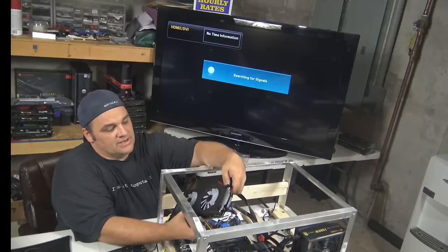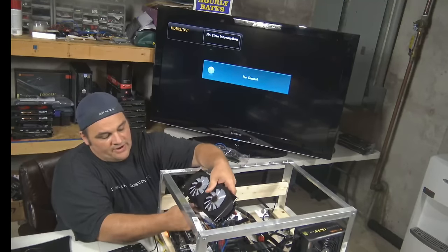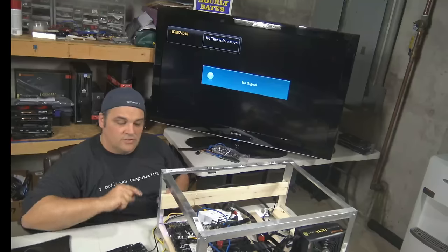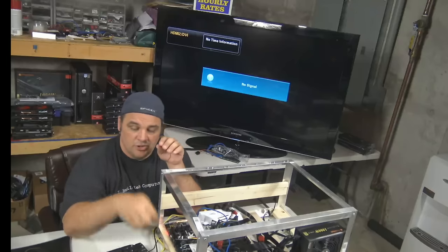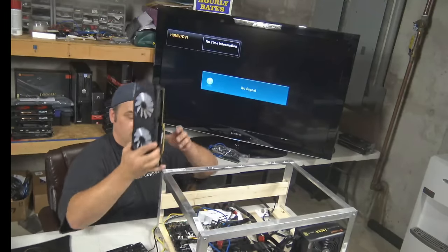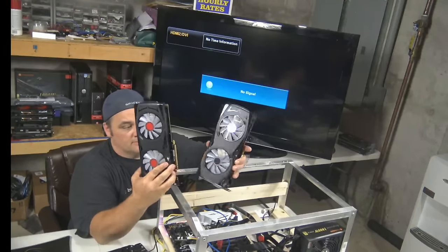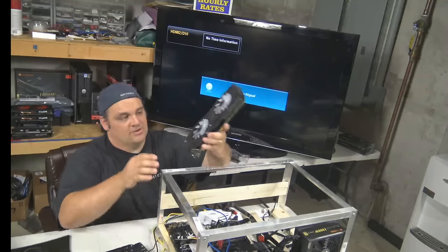And again, like I said, just like I was doing there, start from the top, see if it's stable, work your way down until you find one that works for your set of cards. And don't get them confused. I'm going to make sure that I put them in separate sections in the BIOS, since there are two different XFX cards here. So if you have this card and you're watching, they're different, so make sure you grab the right BIOS. I'll make sure I label it.